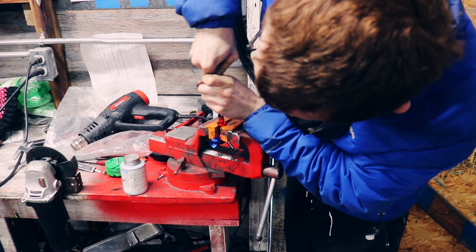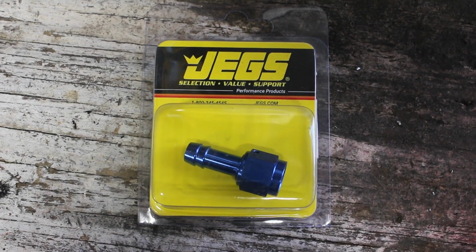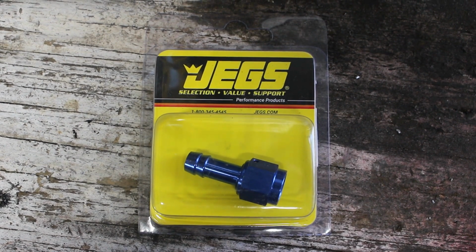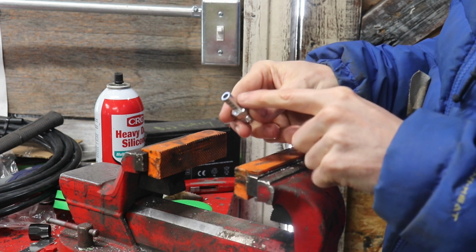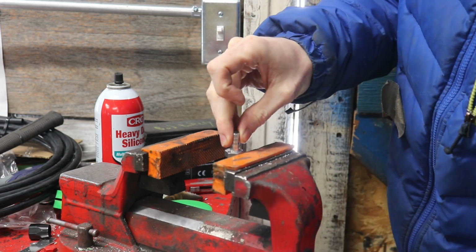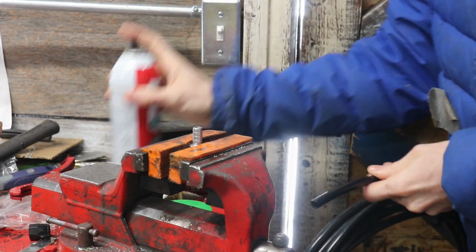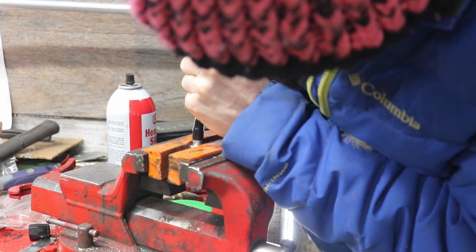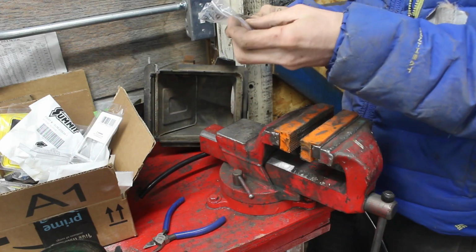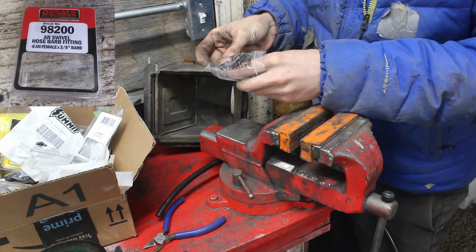After several different trials and errors, I was able to find 2 different fittings that would work for nylon line. So after I tried the push lock fitting, I tried this fitting from Jegs, and this also does not work for nylon tubing. The first fitting I was able to get working was this ICT Billet fitting, which is a male barb to male AN fitting. I'll have a link in the description. I was also able to use a female AN to male barbed Derale fitting.